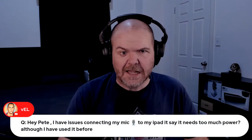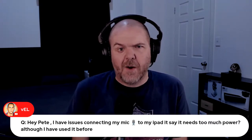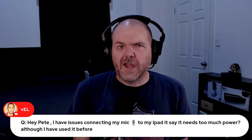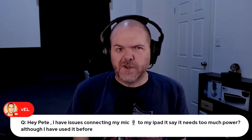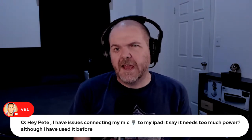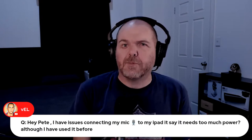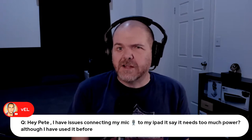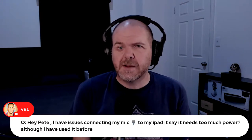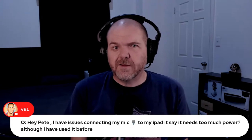Yes, we do. Pete, I have issues connecting my mic to my iPad. It says it needs too much power, although I've used it before. So check the gear that you're using. We did talk about that earlier in the show, but whenever you get an issue with power, it's usually to do with not having a genuine Apple Lightning to USB adapter. The fact that you said it did work before but now it doesn't may be that if you've updated the operating system, it may no longer support that if it's a third-party adapter. So that's the first thing to check.